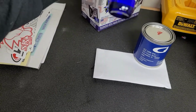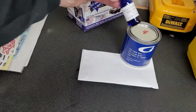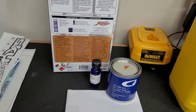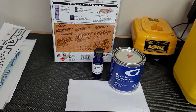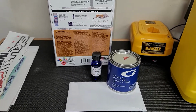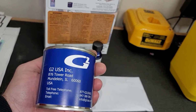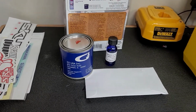And this is the mixer. You mix this into the paint, and once you get that mixed up, I believe there's a 4 to 6 hour window that you have to get the calipers painted, or else the mixing materials in there start to settle, I believe, and it becomes unusable. So it says it's good for about 3 coats on each caliper. So depending on how much you use, you should have enough to go around 3 times on all 4 corners.